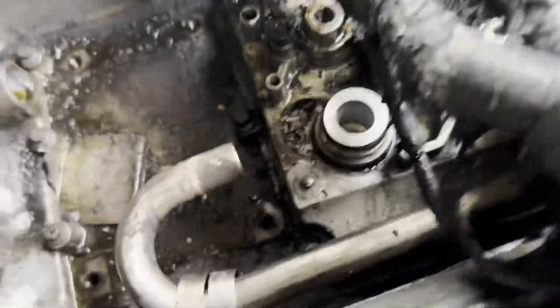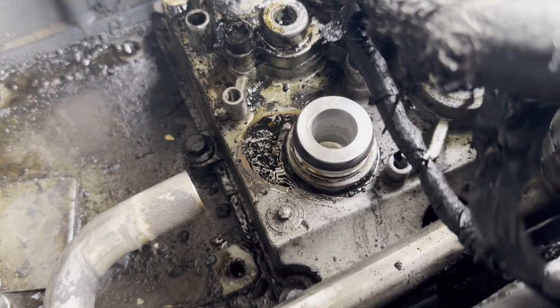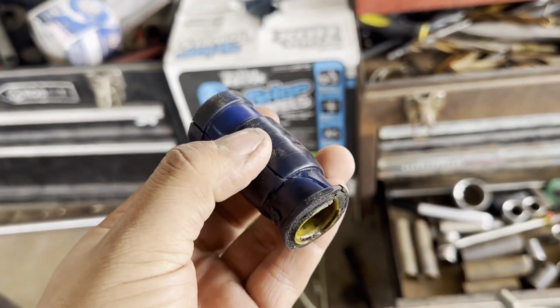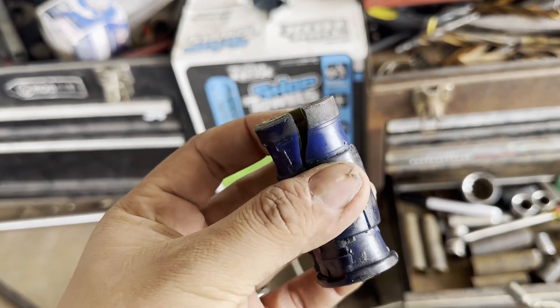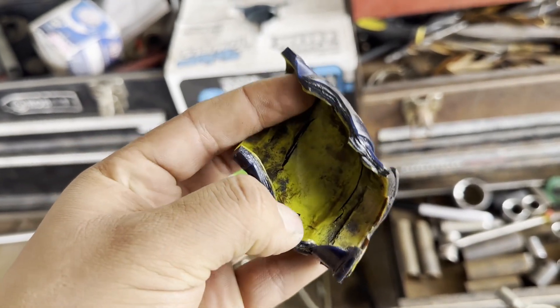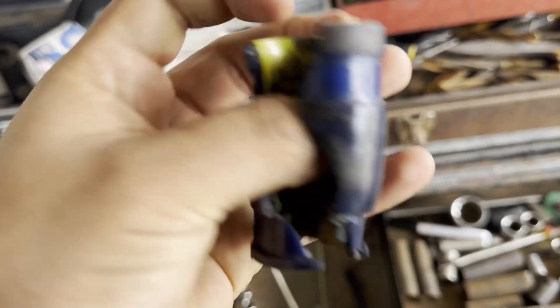All right, we made it home. You can see right there we took off the little cap that goes on the oil cooler — I'll show you the hose that was giving us the problem and leaking. That was this one right here, and just by the looks of it, it's probably the original they put on there. When I got it off I literally ripped it with a screwdriver — I think that was already there, and I think that's where my leak sprung from.